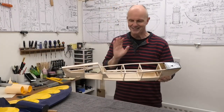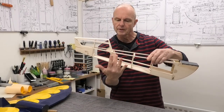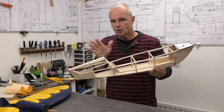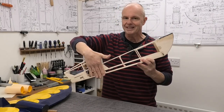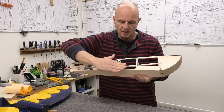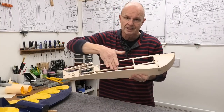We need to do this in a certain order which is a little bit tricky because we want to make sure that all the seams are downwind, downflow. So for example the seam we're going to have here - we need to put the back piece on first and then have the front piece overlap that, so the wind is not trying to push the seam open, it's trying to push it closed. Similarly on the underside we'll bring that up onto the fuselage side so any fuel or oil that comes down won't be pushed into the seam - it'll just drip off the bottom.